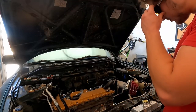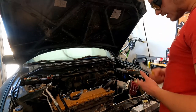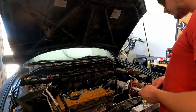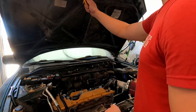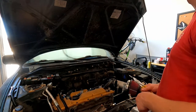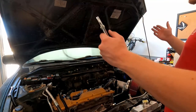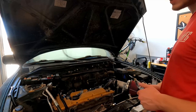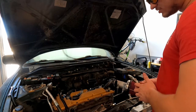Alright, so that is technically out of spec for the pressures, but I got about the right amount of refrigerant based on the factory specification of the car. It's around 1.6 pounds. I put in about three 12-ounce cans. That's about 1.6 pounds, give or take. So I'm going to pull down to around 54 degrees in the cabin, so I'll take it. I'll roll with that. If I need to adjust this later, I can.